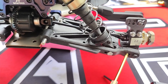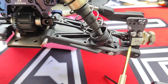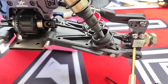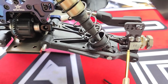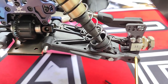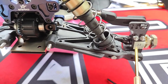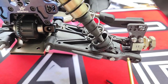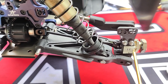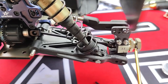Normally when this is run on the short arm setup with the insert relocated on the bottom, you can run a negative 7 offset. But when you run the long arm setup, this offset goes from negative 7 to plus 2. So if you want to run the long arm setup and maximize that, what you want to do is run a wider hex. I also run a 1mm carbon fiber wheel hex spacer.